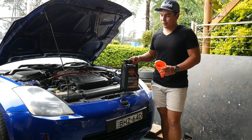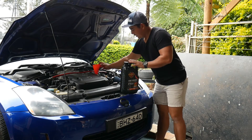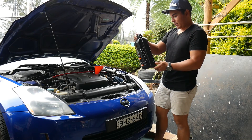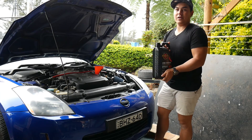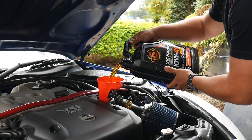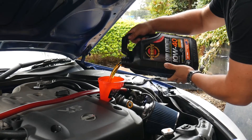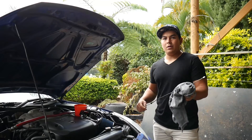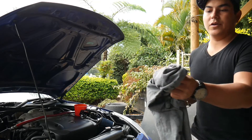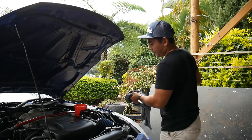The next step is to put your new oil in. You're going to need a funnel, otherwise it's going to be really messy, but other than that it's pretty straightforward. This car takes 4.7 litres — this is a 5 litre can so there shouldn't be much left over. Since you've started putting oil in, you want to check what level you're at, so use your dipstick. You've got a low and a high, so you want it to be in the middle, almost near the high, but not over full.